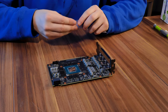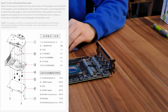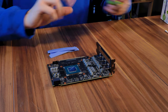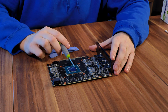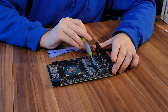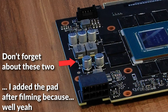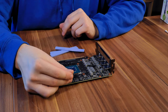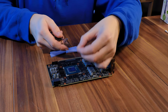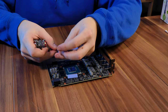Now with the GPU as clean as I can possibly get it, it's time to put on the thermal pads. For this we will consult the non-existent manual that I will put on screen. The only areas that we need to put pads on are these two chips, these three here, and these three here, followed by these three here. We just take the strips, measure it, and that's close enough.